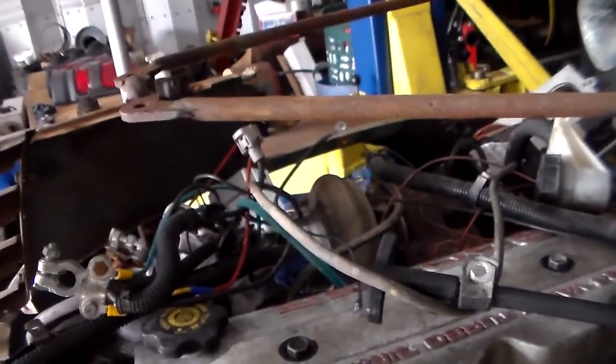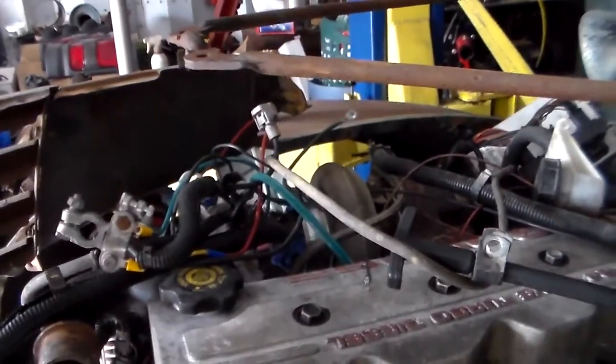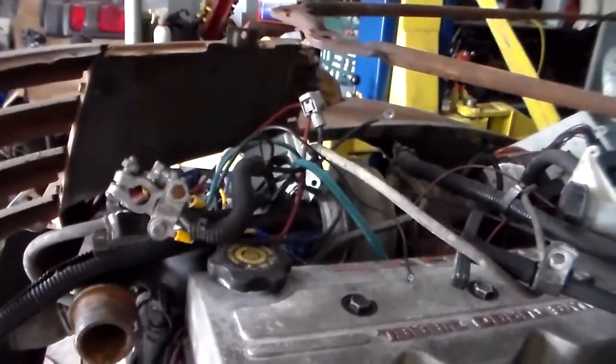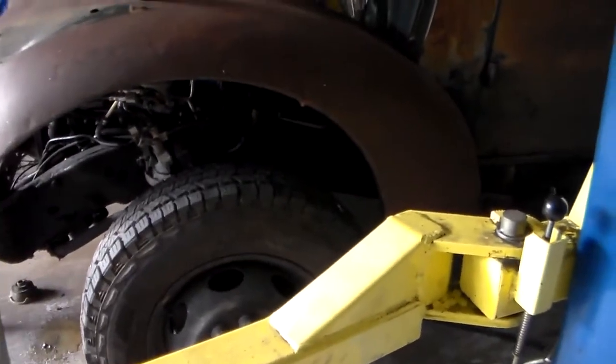It's pretty close, so I'm thinking once I cut this frame off I can drop the front end down just a little bit. I'm going to have to actually raise the cab, maybe — we'll figure it out. If I come forward with it some more, once I come down with the front end, this back of the fender will go back, and you can see where it lines up on the cab over there. That fender needs to go down in the front a good inch and a half. All right, let's get to cutting on this so we can lower the front.